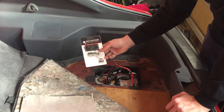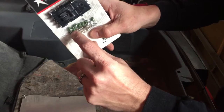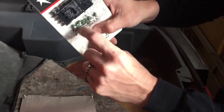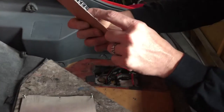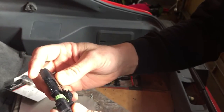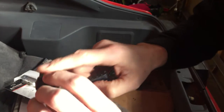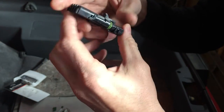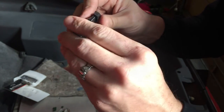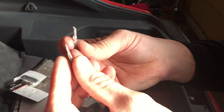If it's on something that you drive daily, this would work really good. It's got some little rubber rings that go around your wire terminals. Here's the connector — you can see that it's keyed, so it'll only go in one way. You're not going to be able to put it in upside down, it just won't fit. It's got a rubber gasket around it that seals nice and good, and it's easy to take apart — a lot better than butt splices.